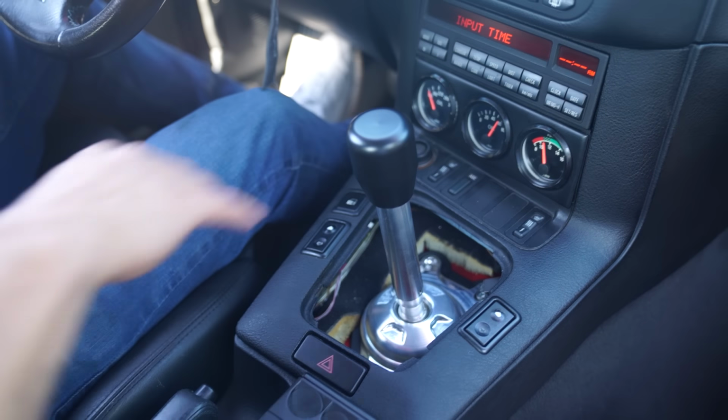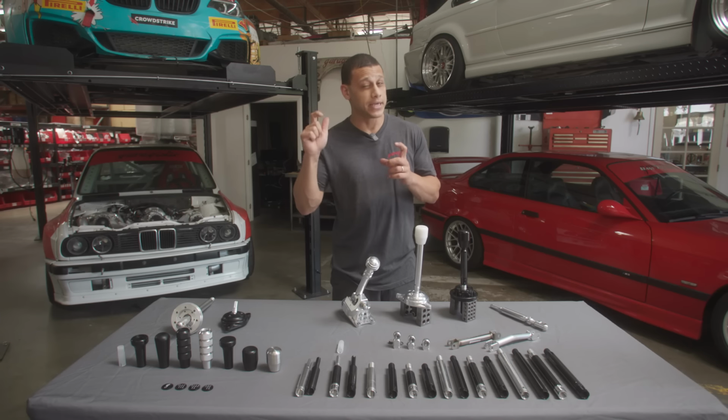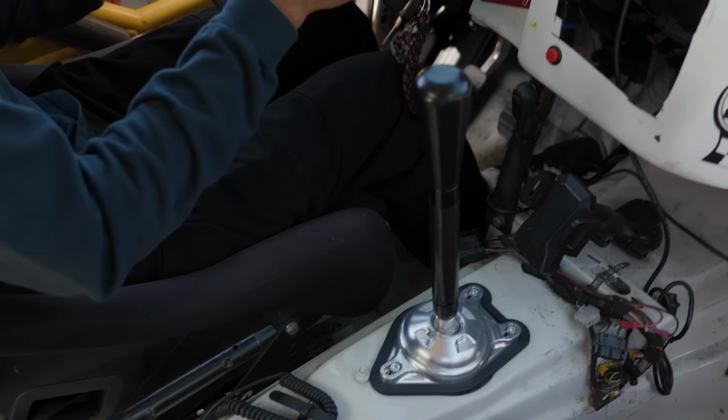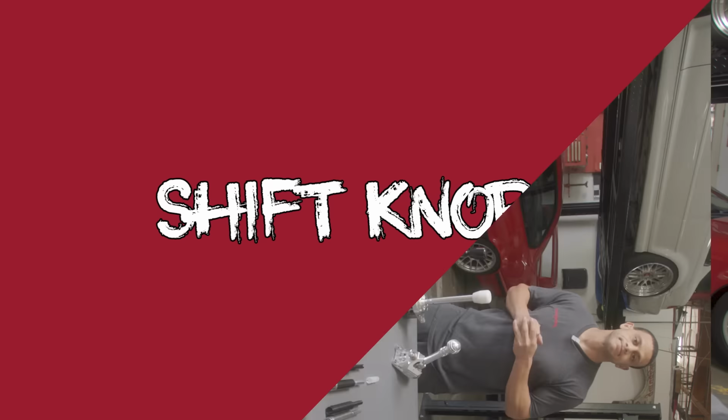So the shorter the rod means maximum effort and least amount of appearance of play. A longer rod will mean least amount of effort to put it in gear, but then it might magnify how much apparent play your shifter might have.